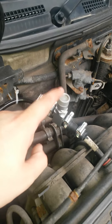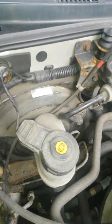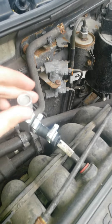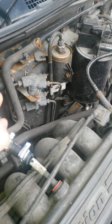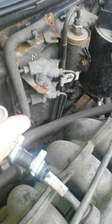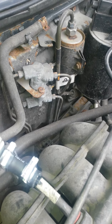I'm just showing the power boost valve that I've fitted to the inlet manifold, on the inlet manifold side of the vacuum servo. I'm just going to adjust it now. You start to hear it — that's the engine sucking the extra boost air in. And then we need to just nip it to the point where that sound stops.